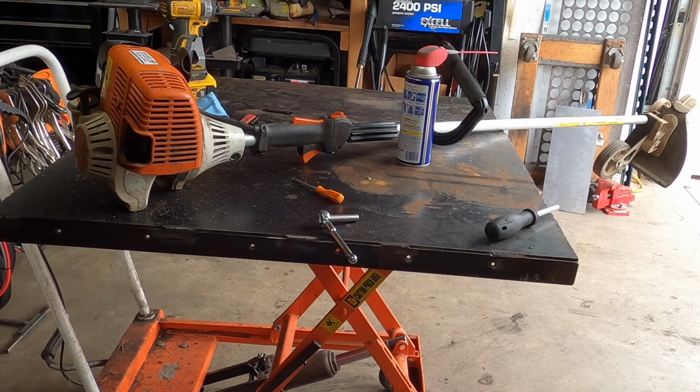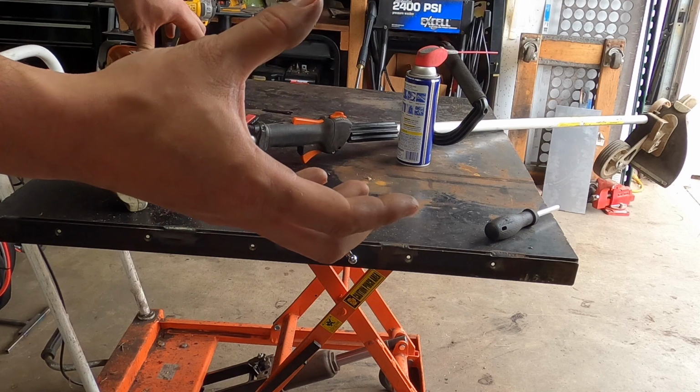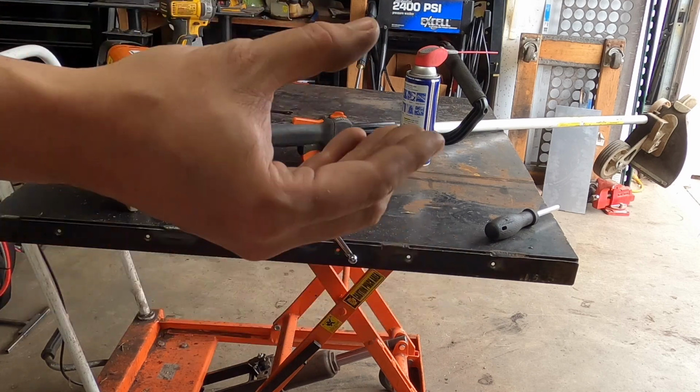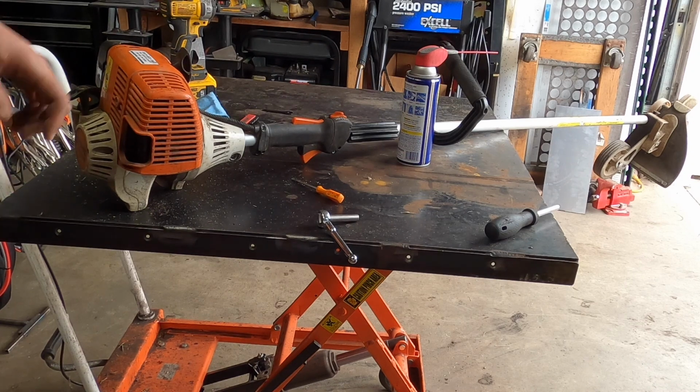Excuse me. We didn't have a scored piston. We didn't have anything with the exception of having to do a little extra work. We found out that it was just fuel or something, maybe oil, that compresses the rings. It doesn't allow them to really expand, it just kind of holds them in place. A little oil, a little fuel, a little jolt of actual running will kind of help free everything up real quick, and that's what happened.